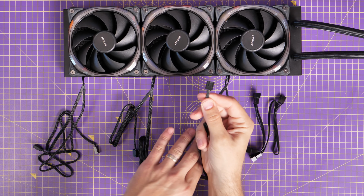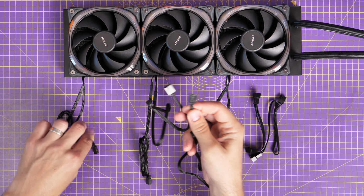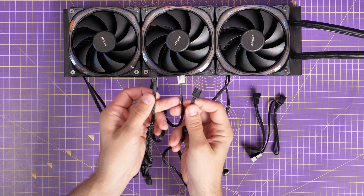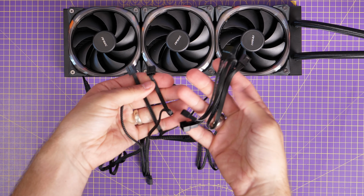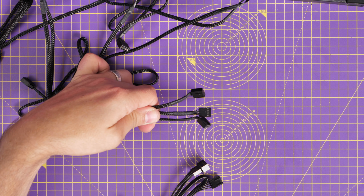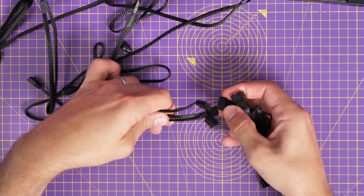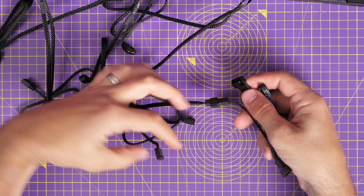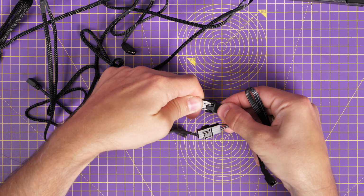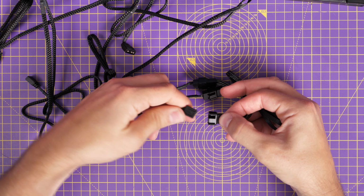And you also then need to worry about fan power, obviously, as an alternative. So these fans from Antec have fan power connectors. We've got 3 power connectors. I'd recommend using a fan splitter for those. You can get these splitters, either Y splitters, which is 2 into 1, or more, so 3 fans into 1 connection. You can buy them as optional accessories, or sometimes, if you're lucky, they'll come with the device you've purchased. And then you've got a single fan connector on the other end.